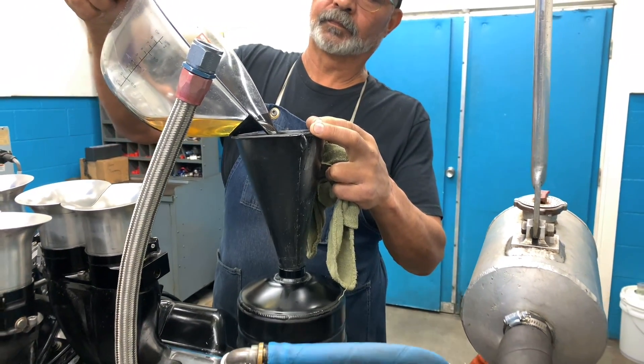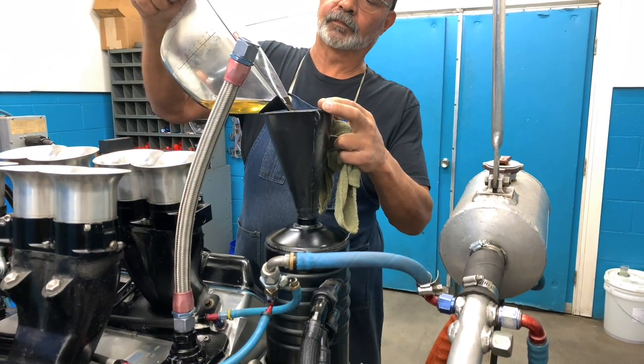And for two, there has to be a certain amount of heat. One of the key things when it comes to the break-in oil — the ZDP in the break-in oil — it needs heat and load for it to work. So without cylinder pressure, without load on the engine, the oil can't do its job. And the job of the oil during break-in is to assist the bedding in, the mating of the ring to the cylinder wall, to establish excellent ring seal, which means high efficiency and high engine performance.